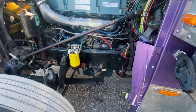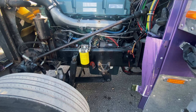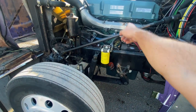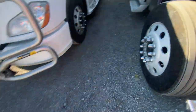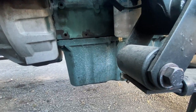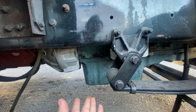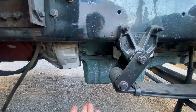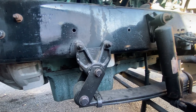The air compressor is $1,100 and I'd love to replace a compressor rather than get a new engine, because an out-of-frame is expensive and a crate motor is like $30,000 for a long block — that's just the block, head, and internals, nothing else, and that's from Freightliner. As you can see, it's throwing coolant all over here through my overflow pipe, and it'll start leaking in the corner. I've sealed this pan up so many times — I went and bought a new oil pan and it's still the same thing.